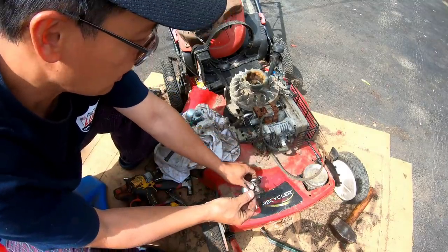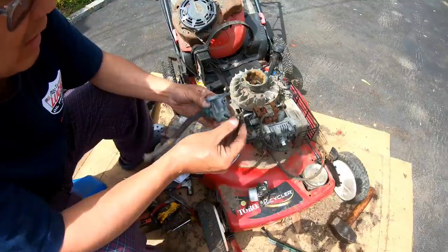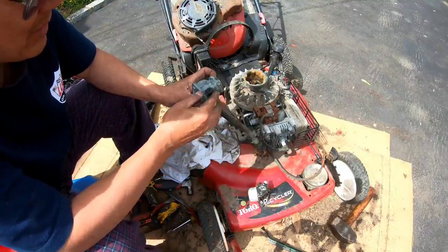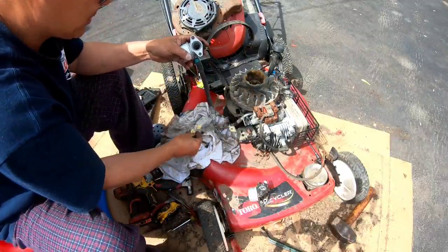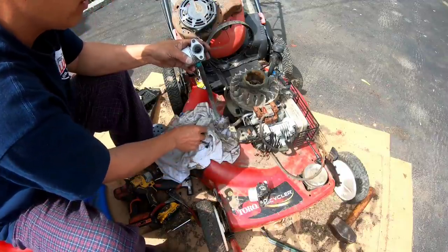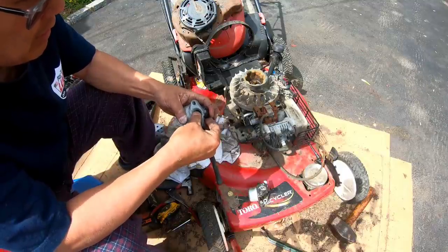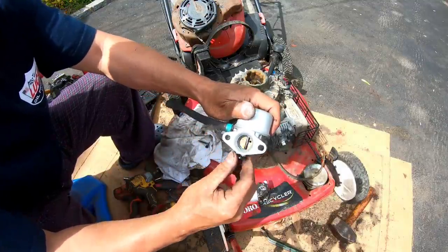See it's the same thing — this is trash too. I wasn't planning on using this at all, because this is just as bad as that one. But looks like I could probably cannibalize this and take this shaft. I'm gonna pull out the choke flap and use the shaft. There we go. And I'll put this shaft onto this one. There we go. Perfect.